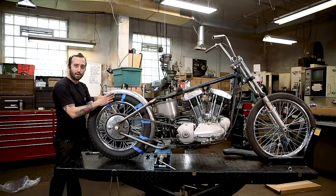But when I'm drilling through the plate for the 5/16 bolt, I'm actually going to drill slightly oversized, because once this thing's powder coated or painted, if it was an exact size hole, your bolt wouldn't fit. So I'm going to step it up to 21/64. This is just the next size larger if you have a whole box set of 64th increment drill bits. But I would just make sure to drill a little bit extra. The holes are slotted and everything, so it doesn't have to be an exact fitment hole. So we're going to drill this out and then we're going to bolt this on.